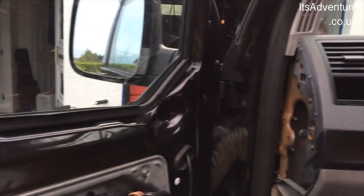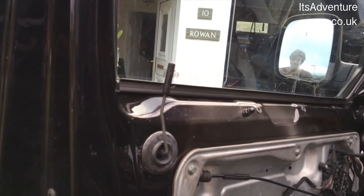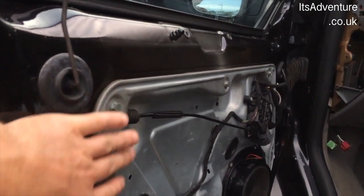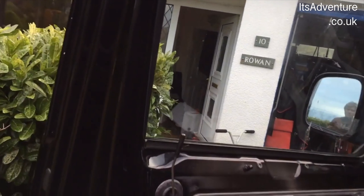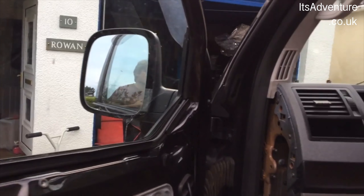A couple of other issues we've noticed: the switches inside the door locks, which show whether or not the door is locked on the dash, have got a fault with both the passenger door and the sliding door. As those switches are £130 a piece, we're looking at an alternative — see if we can get something by mapping some switches, maybe even flip them back. It may be just a cheat to get around it. We might have a look on eBay for a replacement, but it's very difficult to get to — the panelling is actually bolted to the window as well, so to take the panelling out you have to take the entire window out, which is quite a problematic job.